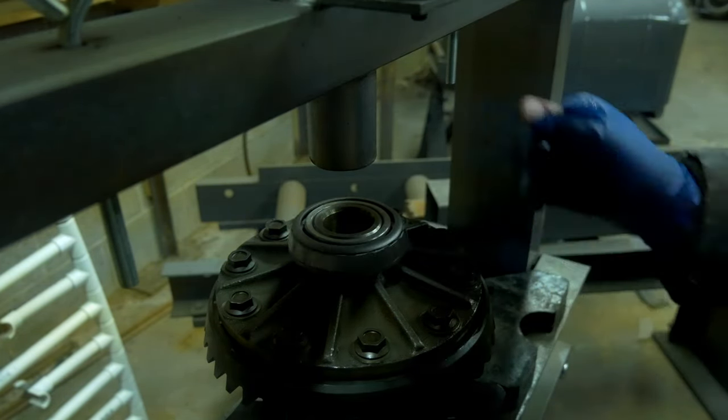So I rotate this thing around three, four, five times in both directions, and it's got a maximum reading pin that, as you're rotating it, you reset. So it will take more force, just like anything overcoming friction, to get going. So the first initial reading you're going to get will always be higher than what it will take to keep it rotating. So just keep that in mind when you're doing that measurement. If it's peaking out around, you know, 15 to 20 inch pounds, don't freak out. Try to look at that needle as you're using that tool around your little circle path there.